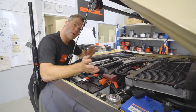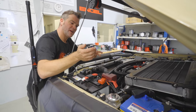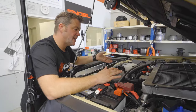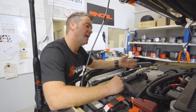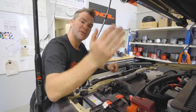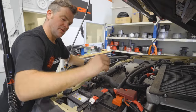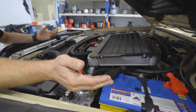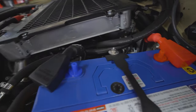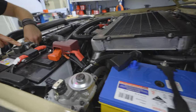But that's the last thing you want in that situation because you want to have it still connected. So we put an override switch in there. If you've got a situation where you want to winch, you have the engine running — in these cars you just put it on high idle, which is great because your revs are slightly up and the alternator can create more charging power to the start battery. You press the button for the permanent battery link so even if the voltage drops the battery stays connected. In that scenario you've now got your alternator, your start battery, and your secondary battery — your get-home-safe battery — which needs to be connected with heavy gauge cable on positive and negative to positive and negative on your start battery. Obviously positive runs through the smart solenoid first.